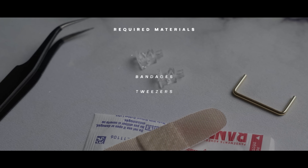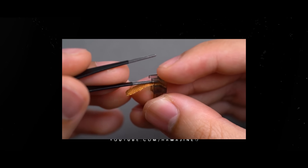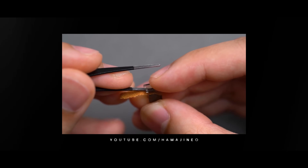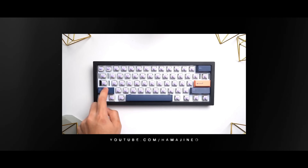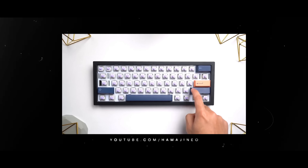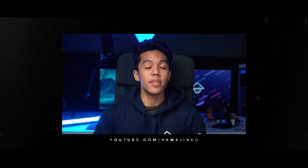Next is one of the most popular mods: Holi. Created by Tet and popularized by Hamaji Neo, this involves applying a sheet of bandaid on the upper part of the stem hole, which I'm now going to call the stem mouth. This helps cut down on the space that the wire can travel, thus reducing the volume of rattle. Additionally, the soft bandaid surface dampens the noise that the wire makes. However, because of the thickness of band-aids, Holi will usually be mushy and sticky at first, and can sometimes be scratchy if the bandaid is frayed and dragging around inside the housing.